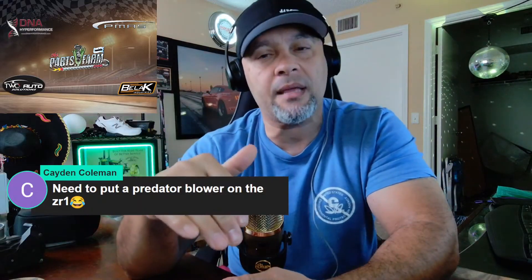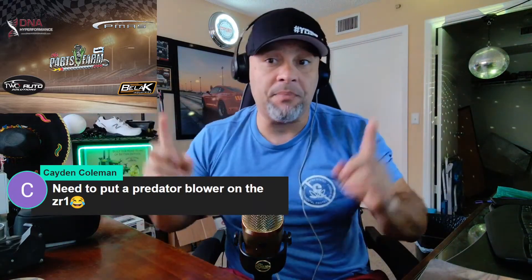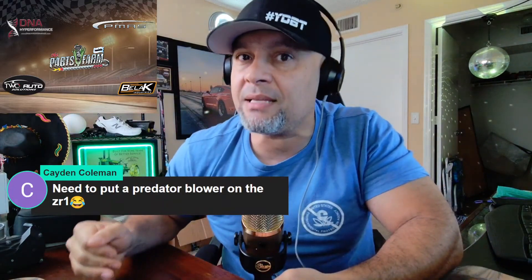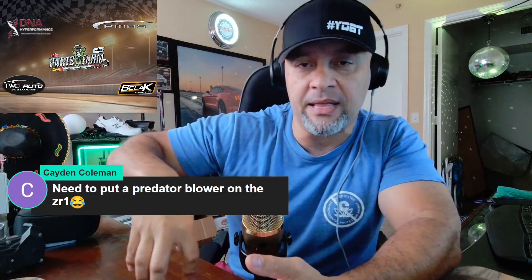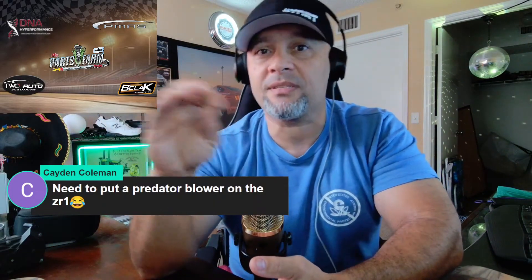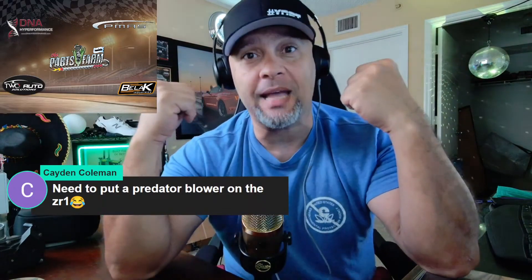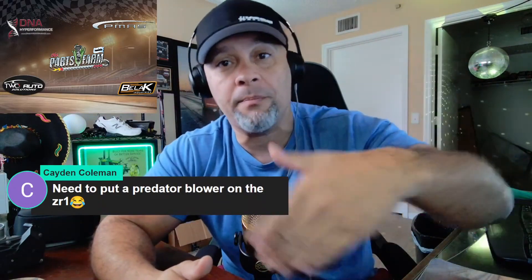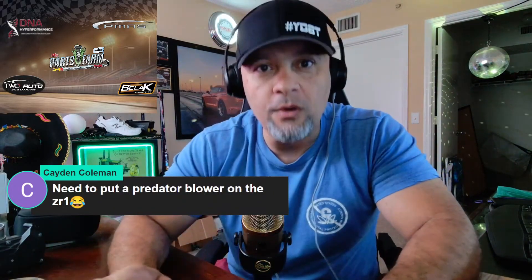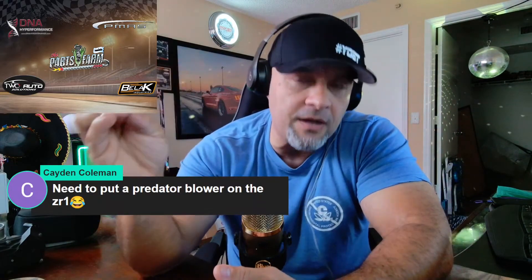The fuel system is something I really got to think about. After watching a YouTuber's video on how the C6 fuel tanks work — they come off on the side but there's a big tube in the front that brings them together — I realized I can tap into the bottom of the tank. The problem with tapping into the bottom of the tanks is that the fittings are always loose, so it's almost better to have a module in there that pumps through the stock setup. It might need to be like a Fore Innovations fuel system. The other question is: if I key on, will the pump turn on, or does the computer have to be connected? It's a variable fuel pump that goes high or low depending on demand.